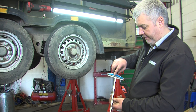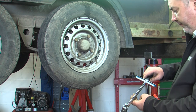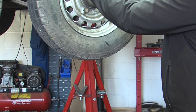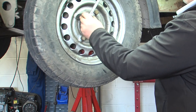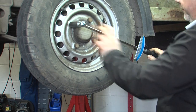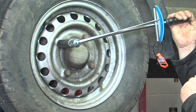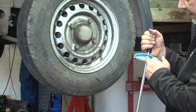I'm actually going to tighten it up to 60 foot pounds because I'm going to finish it off with the digital torque wrench. To use one of these you put the socket on as usual, and as you turn it and apply pressure the lever will travel up the scale. The more pressure, the further the lever goes up. It was hovering at 60 foot pounds — not too accurate, it was wobbling.